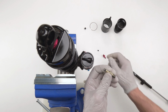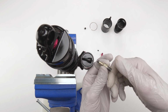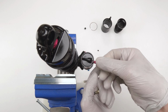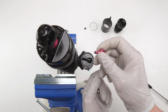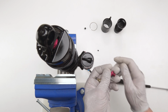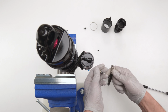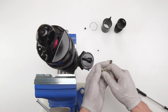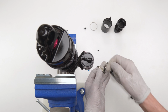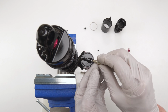This is going to be the first time I'm using it, but the advantage that this would have over this, when it comes to unscrewing and removing it, this one here, you have to remove it by the adapter, and you got to be real quick or you could seep air out while you're removing it. Whereas this here, technically, it's lossless. We should be able to remove it from the hose side, and we shouldn't lose any air at all because the pin will go back, allowing the pin and the Schrader valve to go back. Let's give it a shot, see if it works.